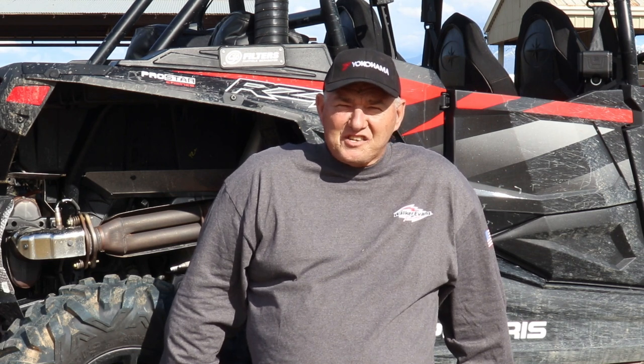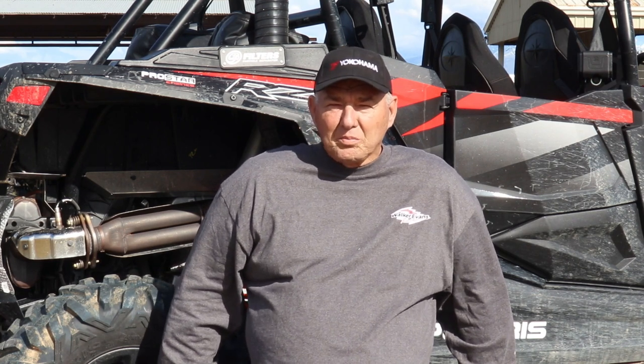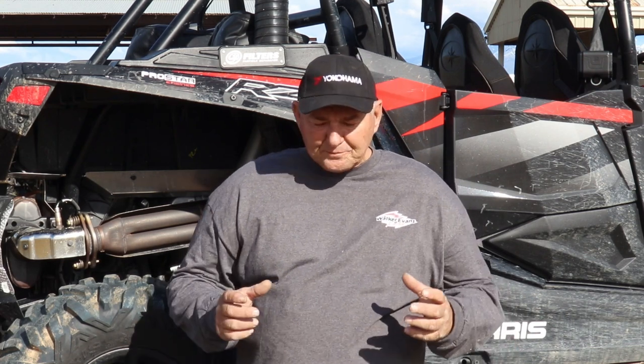At that point I would probably just upgrade to the velocity shock. Walker Evans showed me the velocity shock — really high-tech and just a beautiful piece of equipment. Was it worth $1,000? That's something you'll have to decide yourself. It's definitely an improvement and I think it was worth $1,000. Is it a night and day difference from stock? No. Is it better? Yes — probably 50% better. The nice thing is the dual rate spring system gives you so much more adjustability: you can move the lockout ring to make the shock perform differently, and you still have your compression settings — more adjustability for different terrains and types of riding. It just makes the machine what it should have been when you bought it.